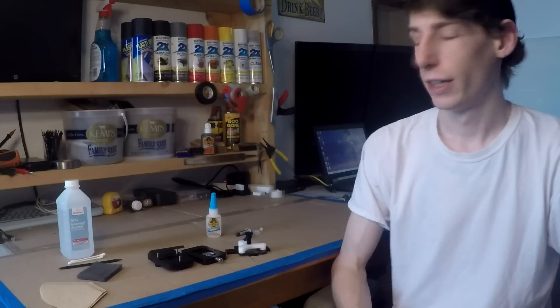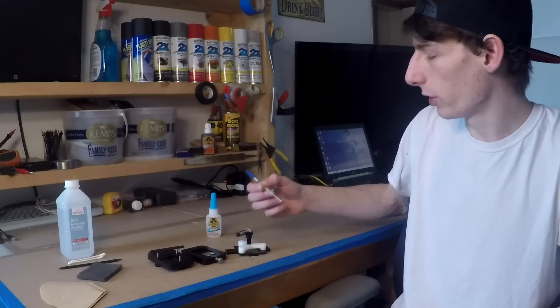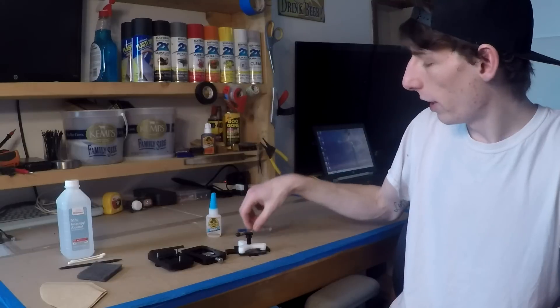Hello YouTube. I'm sitting in my mod shop today and I decided I will be delidding my 6700K. I'm not doing this just purely because I believe it will make my CPU's temperatures a lot better or just improve its performance overall. I've more just been reading a lot about this lately and it's actually really interested me. I see so many results of people getting actually a lot better temperatures by using thermal interface material like Coolabs Ultra, and I just wanted to see if it was actually the real deal.